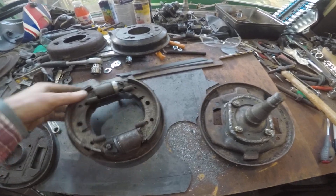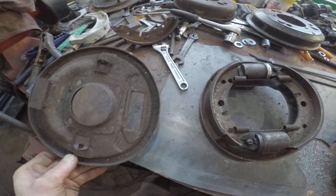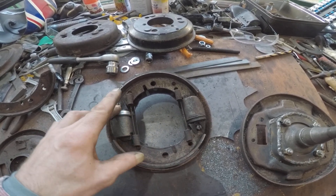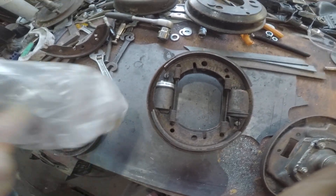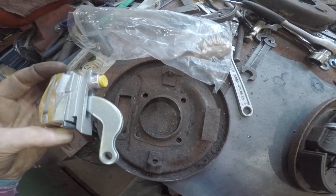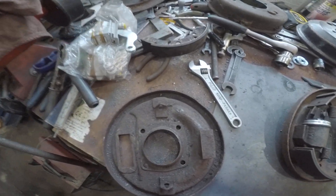What I've done is bought some Morris Minor 7-inch back plates. These are the rears, and these are the fronts. The fronts have got twin leading cylinders and shoes, and the rear's just got a single actuator. So that will fit something like that, and I can run the handbrake off this lever here — basically the same as my Minor brakes.